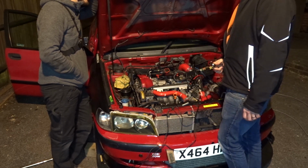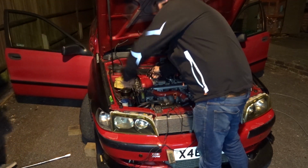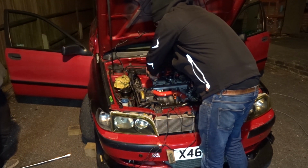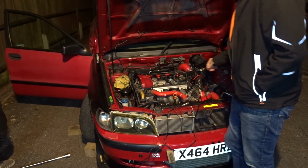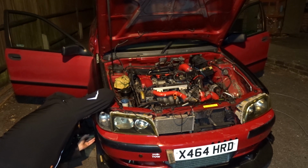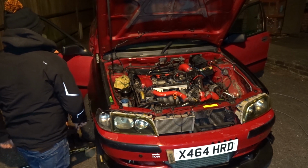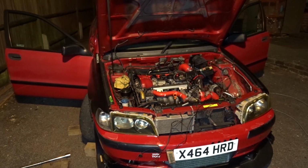Yeah. Can you put minus 90 in the offset? Yeah, I can. Shall we do that? Try with the gun again, see if we've still got a static light. Unplug these, flip the signal, see what the timing light gives us first, yeah? Bang on the mark at minus 90. Ready? Yeah, go for it.